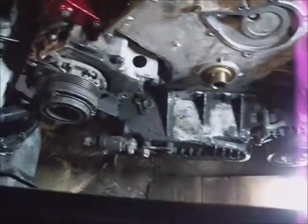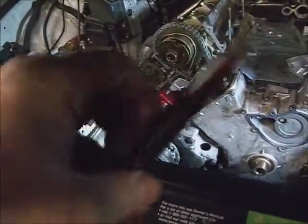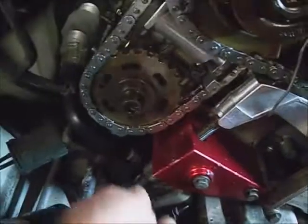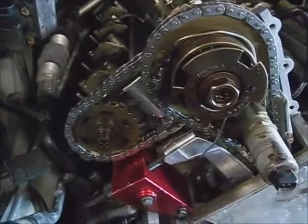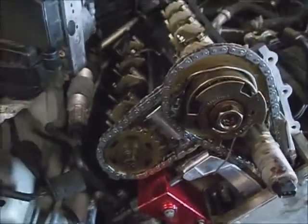While I was down there putting the oil pan on, I went ahead and pulled the crank pin — this tool here that aligns the crank on top dead center by going through the flywheel. I've got the wire pretty snug against this tension arm, and I'm going to back this bolt off and take this block off so I can put this top timing cover on. The timing's all set on it.